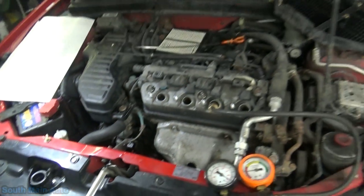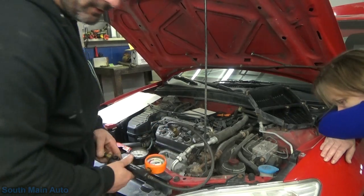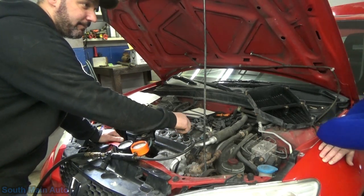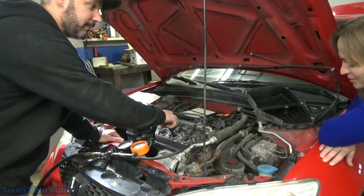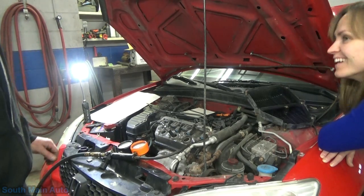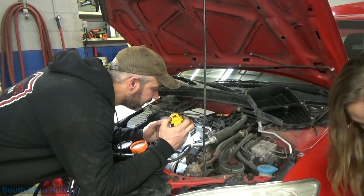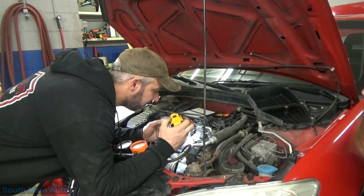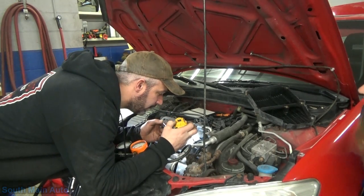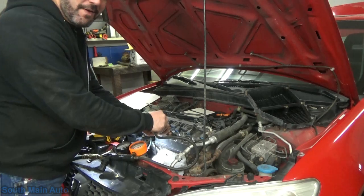Not supposed to have compression in there, fella. So those were our two worst cylinders. Head gasket's blown cylinder to cylinder — or something thereabouts. We're going to get real technical; this is low-tech time. You don't have to use one of those fancy ten-thousand-dollar scan tools. That's cylinder number three — this one had 125 psi.